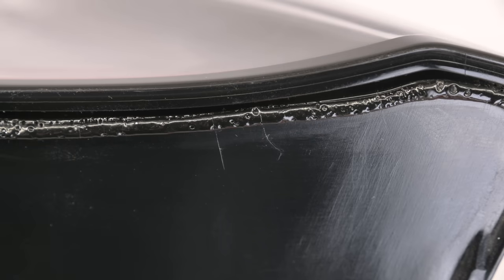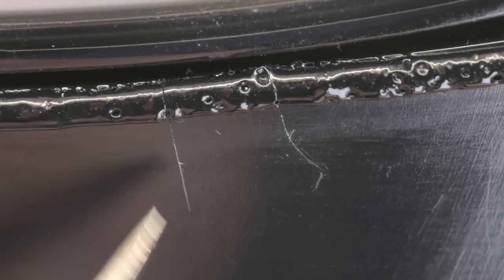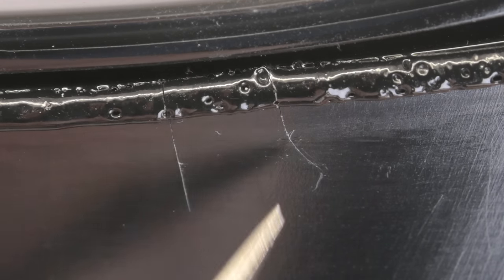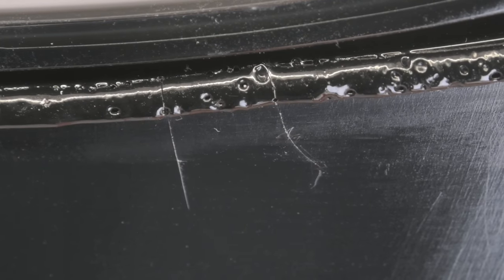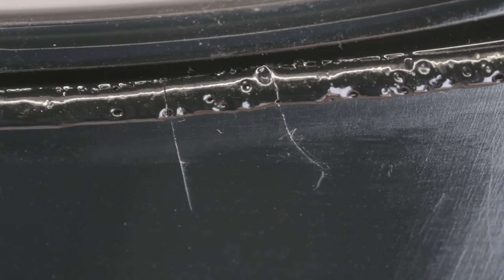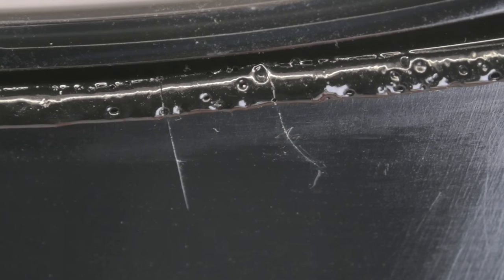When we took this one out of the water bath and had a closer look, we could see that there were actual cracks — not just places where the weld hadn't taken. All the way along these cracks, water can creep in, and that probably accounts for why there was so much condensation in there. We've got another light we took out where the weld had not taken on one side and air was leaking all the way along — still repairable, but not a good situation. The next thing we've got to do is dry these units completely inside and get rid of all the moisture.